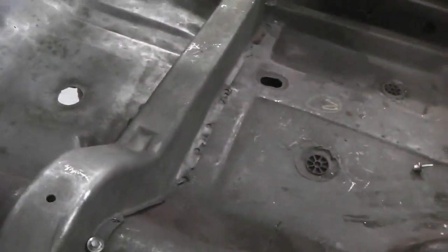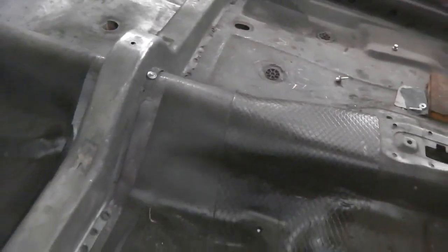We've still got to weld up that chassis fork there. So it just covers a couple of the welds, about four of the plug welds here. And obviously the plug welds are in, but we can't secure the cross member just yet. A couple of repairs to do on the cross member. We need to get the fork in, but we're closing in now. Looking good and closing in.